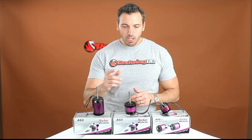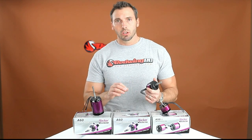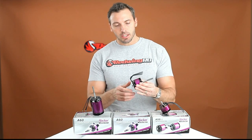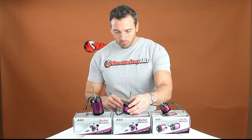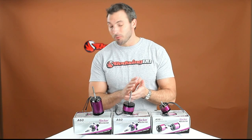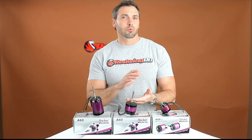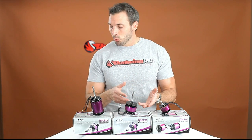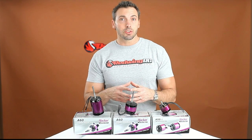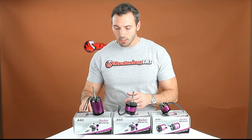The 30cc system is even more competitive. We kept this one really strong and conservative in the weight ratio, going with the A66XS motor. With this system we have a total of about 48 ounces. With a 30cc DLE at three-quarters of a tank of fuel, you're going to be at about 54 ounces — so that's six ounces lighter than the gas engine setup. Very competitive.